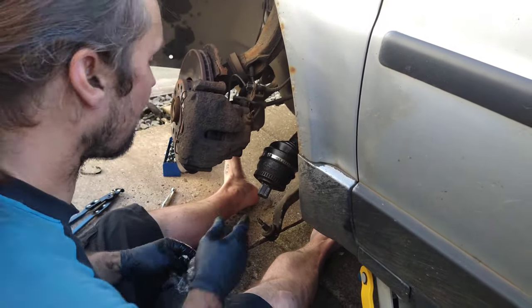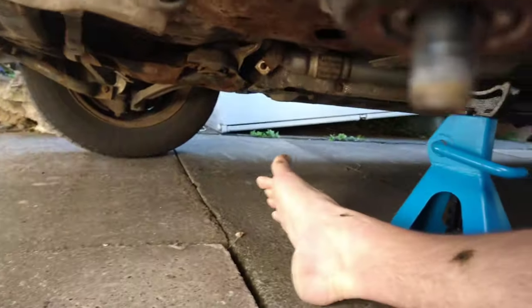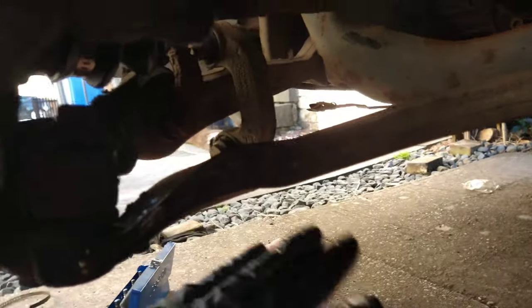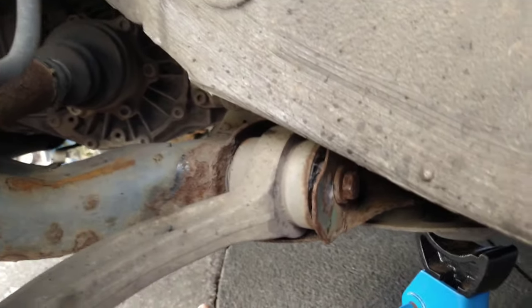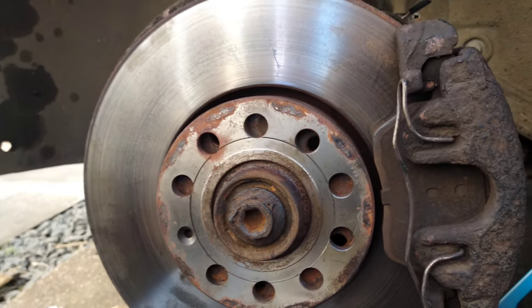That's it done — now I just have to put it back together. This will go back in here. I'm just tightening up these two nuts — one there and the bottom one on this side. Then I'll jack it up under the ball joint and get this arm level, close to how it would be on the ground, then tighten that up. All I have to do then is put the wheel on, tighten up the wheel, and torque up the center bolt. Hopefully this has helped somebody. It had been needing done for a while — I only noticed by chance that it had burst — so I decided to do the joint and put a cover on it. Thanks for watching.